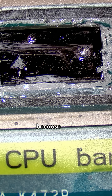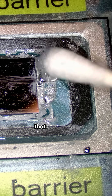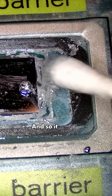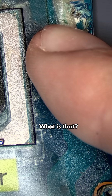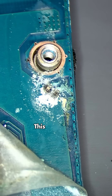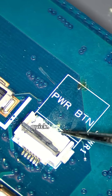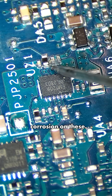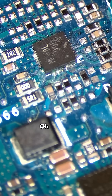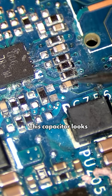I just don't want this getting everywhere because I don't want it to get on any of these chips. If you get a drop on one of these chips, the gallium inside of that liquid metal will eat away aluminum very easily. There's a problem. This looks pretty bad, pretty corroded. We're going to go ahead and take a look around real quick. Look at all this corrosion here, corrosion here, corrosion here. So there's our problem. I think this capacitor looks pretty janky.